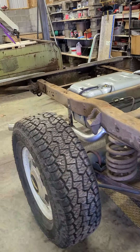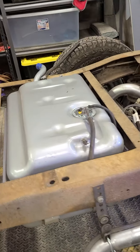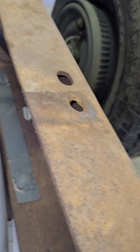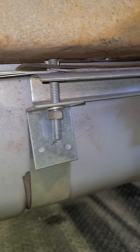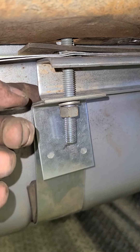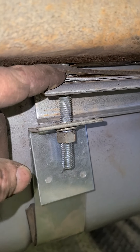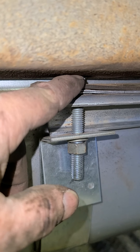I have the blazer style tank dropped in. Fits in there really good. I made up these little plates with carriage bolts welded on for the hangers. Here you can see the tank strap comes up, pulls onto this bracket — it's welded to the tank up here. It's pulled up tight, and there are these little tabs so they're resting on the frame.